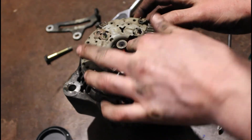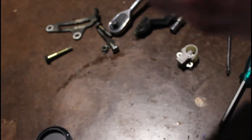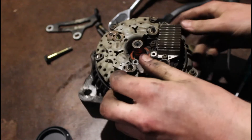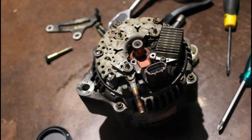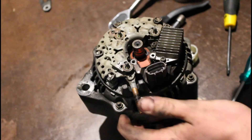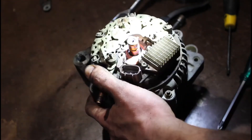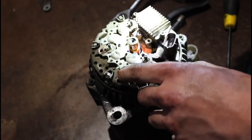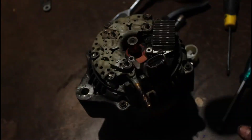There's a little bit of crud in the back of this alternator, so I'm just going to give that a blowout — and that looks fine. Having a little look at that commutator shaft to see if there's much wear on it, but this one doesn't look to be too bad. I think we can just roll with that — it should be fine.